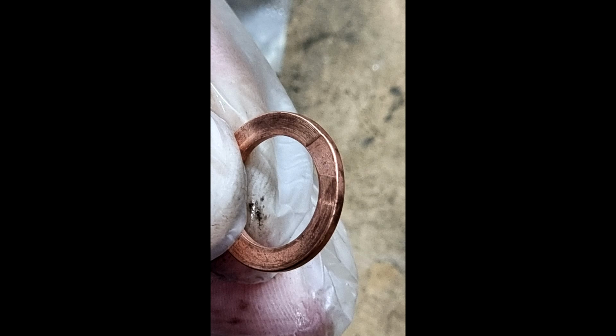And you know what? I'm probably just very, very unlucky, but this is a brand new copper washer. Not sure you can see, but I'm going to throw up a little picture on the screen. There is an indent on this brand new copper washer, so I was just squirting out the side. I chucked a new copper washer in and it's sweet. There are absolutely no leaks. What we're going to do next is throw it all back together, and then we're going to do some settings on the Haltech.